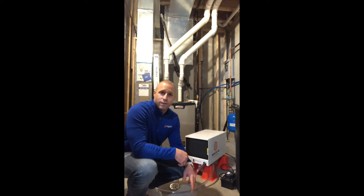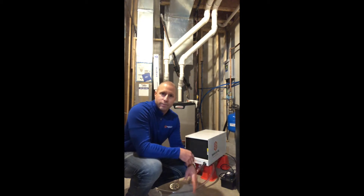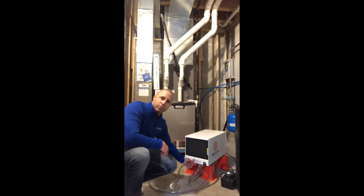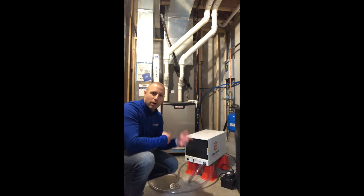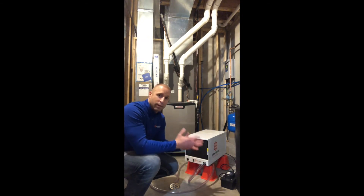So to prep it as we get into the winter season, there's a few things that you want to do. The first thing is just make sure that the inside of the dehumidifier is nice and dry — no mold, no bacteria can build up in there, and we don't get any algae buildup. So you're going to turn the fan switch on and run that fan for about two hours. Once it's been running for two hours, any residual moisture inside that system will be dried up and you'll be in good shape.